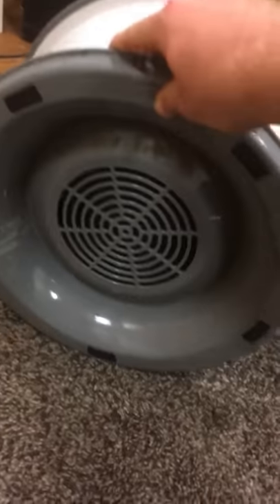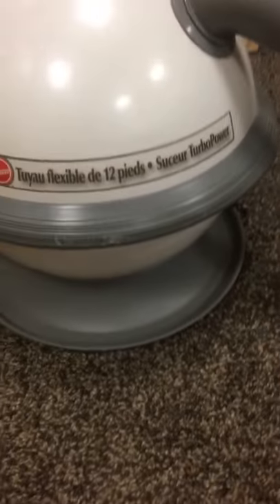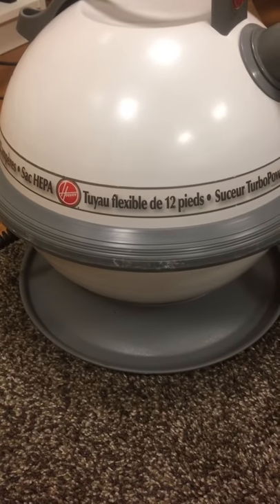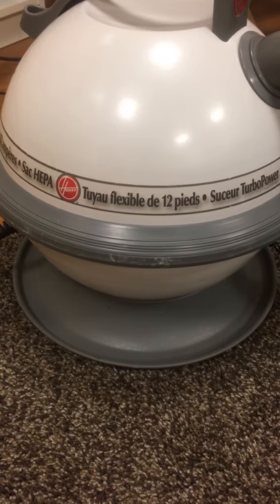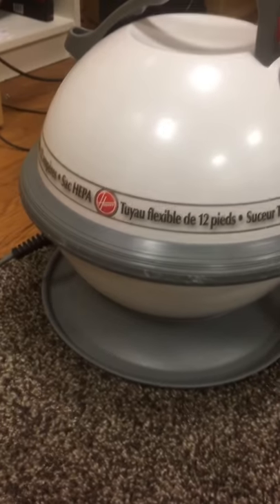The reason why this design was flawed is because, if you think about it, if you're vacuuming a dirty floor or dirty carpet, the exhaust here is shooting out and blowing the dust — virtually blowing the dust off the floor into the air. And what is the point of having a HEPA bag and good filtration if you're just blowing dust the vacuum hasn't picked up yet back up into the air? That's the main issue with this vacuum and all others made to float on their exhaust — it kicks up extra loose dust lying on the floor because the exhaust air is blowing right from the bottom of the vacuum.